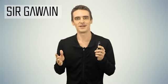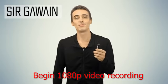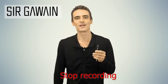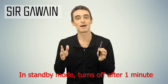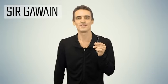If you're going to take video with the pen, once the pen is in standby mode, simply press the top power button down for two seconds, and the green light will flash three times, letting you know it's now beginning to record a video. While in video mode and the pen is recording, when you're done recording the video, simply press the top power button once to stop the recording, and the pen will then save the file and return back to standby mode. Keep in mind that if the pen is in standby mode for 60 seconds without any input from you, it will then shut itself off to save battery. That's how you record video with the pen.